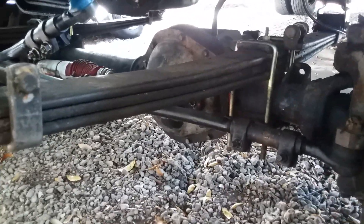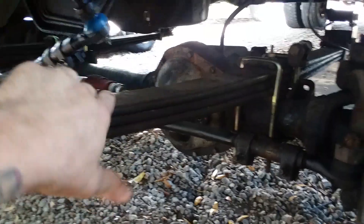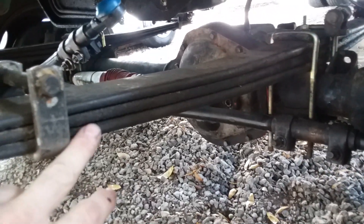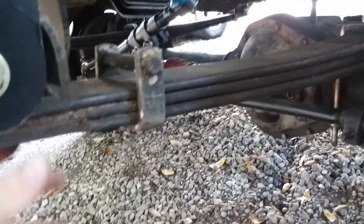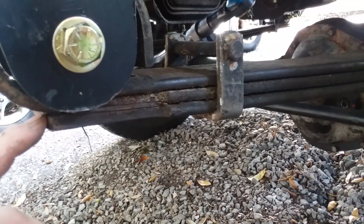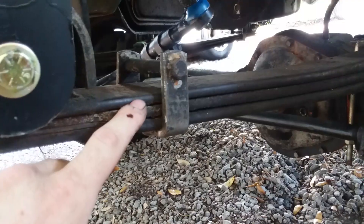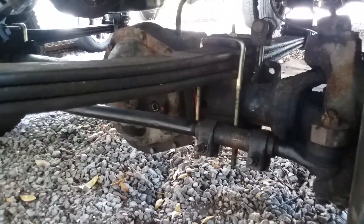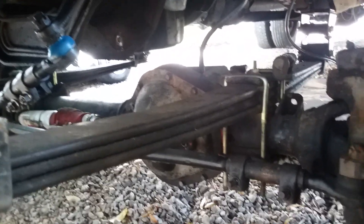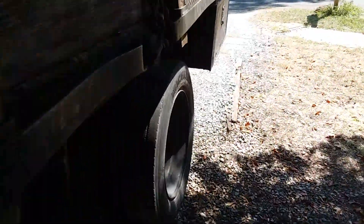Mine is actually lifted a lot more than I thought, because my axle came off a '91 cab chassis, which apparently has a lot more heavy-duty suspension. I've got three spring packs here — if you get your axle off a regular OBS F-350 it won't have this bottom one, just the two. That added a fair amount of lift. This is supposed to be factory ride height where you'd use four-inch blocks to level out, but I'm using six-inch blocks.